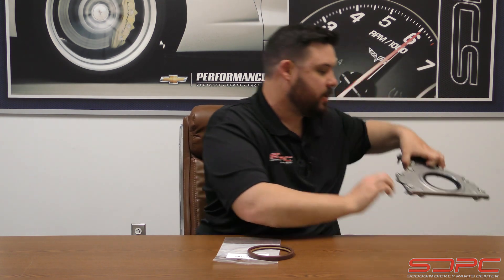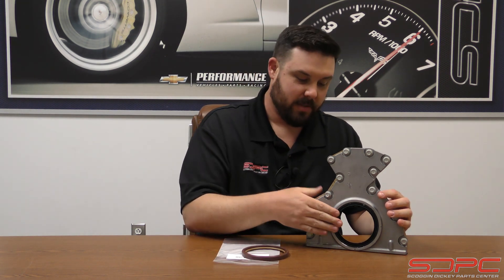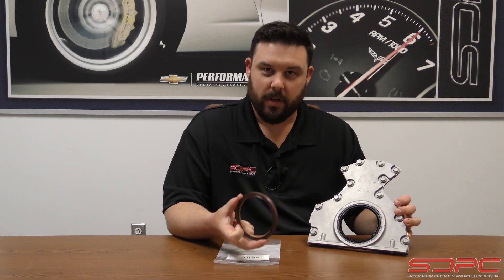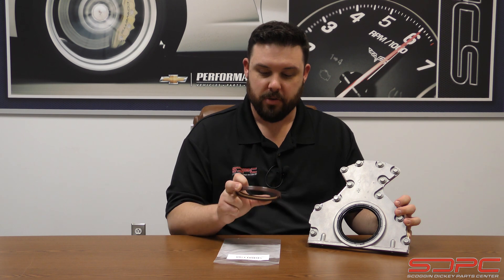What I mean is illustrated by this LS rear cover. The LS and LT do use the same style rear main seals, so this will work for both. This is an LS rear cover with a stock seal in it, and you can see the difference between how they're shaped and how they're made. These aftermarket seals are made out of a nice high quality Viton rubber. They are reinforced and rigid, and they are a nice low drag setup. There are a couple reasons in their design why it'll help in that vacuum setup.